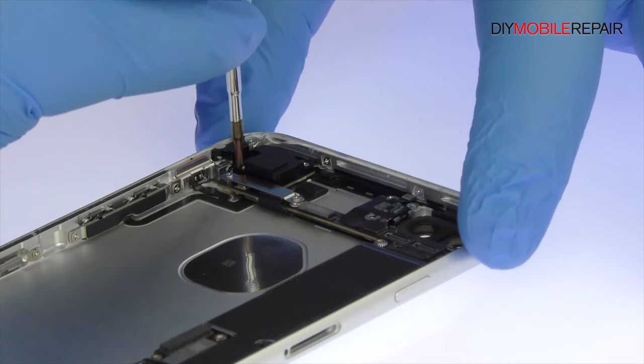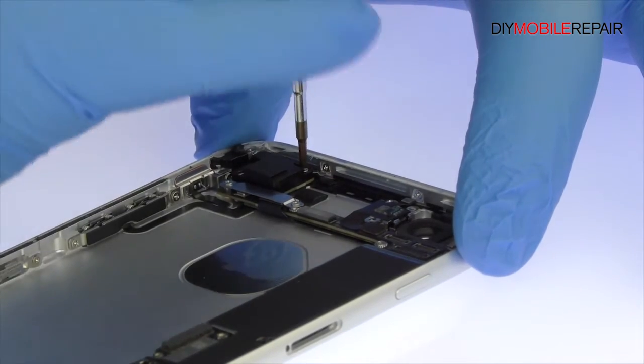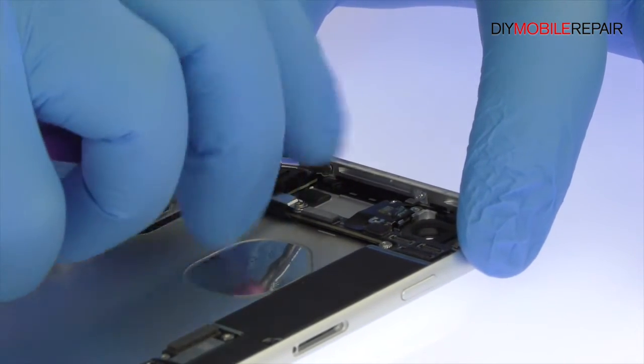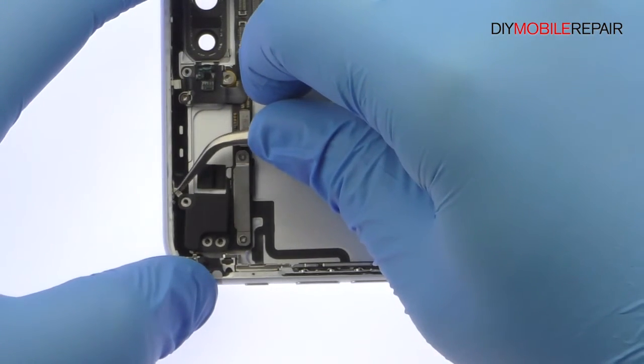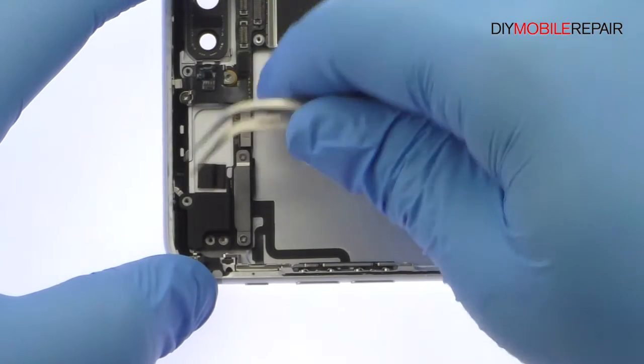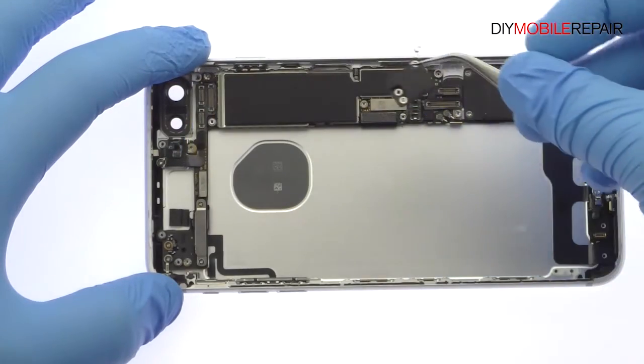Before digging the iPhone 7 Plus logic board out of the rear case, it is necessary to attack a bevy of Phillips and standoff screws. Dispatch a few connectors and remove portions of the antenna assembly, most notably the antenna flex cable, which acts as a bridge between antenna pathways and the top left Wi-Fi antenna.